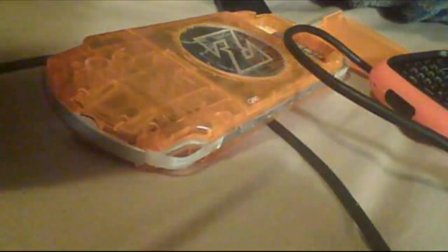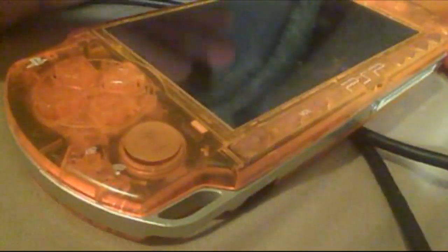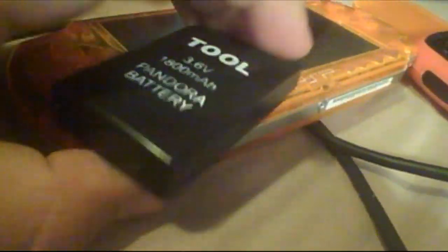If your Magic Memory Stick did not create properly and all you get is a black light, that means you're either not holding the proper button or you didn't make it correctly. The Pandora battery alone without the stick just turns on the PSP light — it's not going anywhere on its own. But the Magic Memory Stick is what triggers the custom firmware installation. Thanks for watching — please like, comment, subscribe, and I'll see you in the next one.